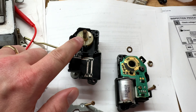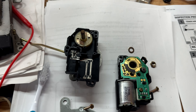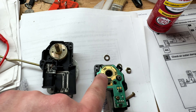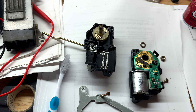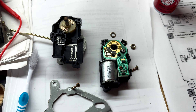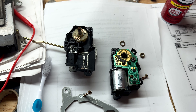I'm going to clean the fingers with a toothbrush and the contact cleaner, and then he told me to apply some dielectric grease on the area where these fingers ride. I already tested with the power probe — I applied power and the electric motor in here is perfectly fine. It does still move everything, but what I was told is that because it cannot detect the position, that's the issue.